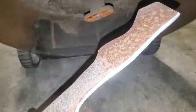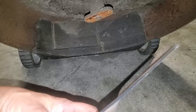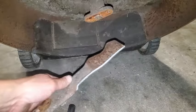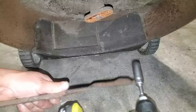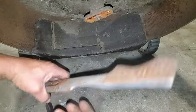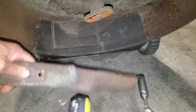All right, got this nice sharp. Ooh, look at that shiny. And I just like looking down the edge there. Probably can't tell, but got a pretty good angle on it. Sharp, and I just want to make sure it's not round, that it's got an edge, not rounded off. Pretty good. I like taking a piece of steel and just knocking off the last little burrs. You can use a punch, something like that, just a piece of steel to kind of blunt the jagged edges if there are any left. This one's pretty good. This one's really good. So it's kind of deburring it. Deburr and burnish.